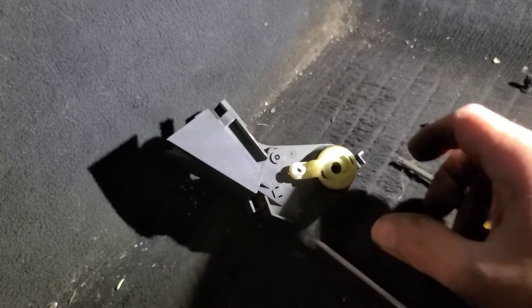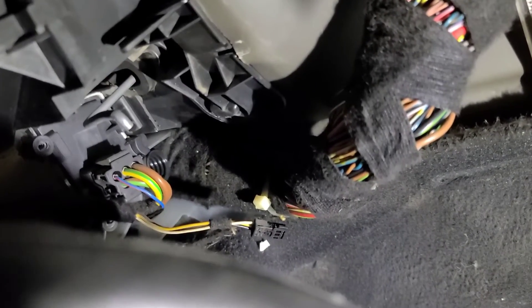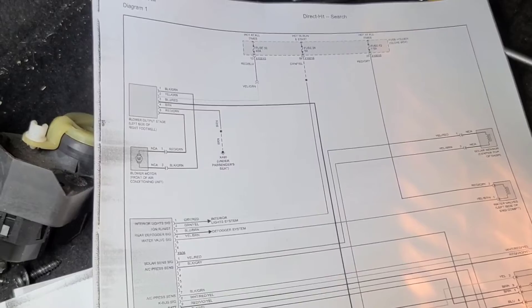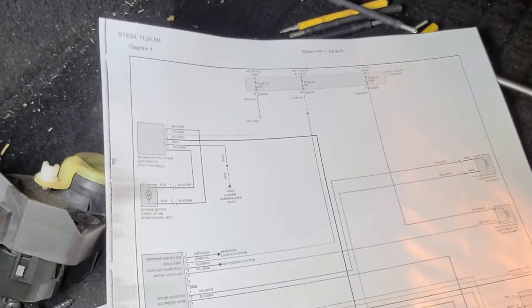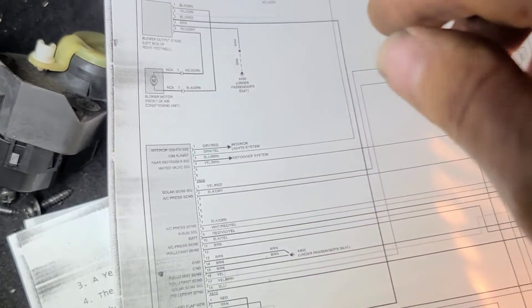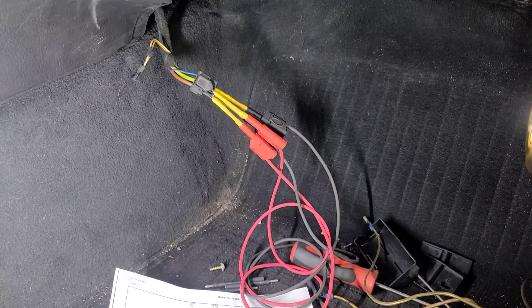There is a rod that you have to go in and I used a little hook to pry it up. Then you have to slide it towards the passenger fender to the right side because it's sliding into little slots, and then there's a wiring connector that has to be unplugged. Now the final stage resistor is back there — I think it's just clipped in. The yellow and green wire is power all the time from fuse 50, a 40 amp fuse. And the brown wire on the second row is ground. We're going to jump power to the blower motor — pin 1 and pin 5 — to bypass the resistor, and you can see with the resistor bypass, the blower motor runs.